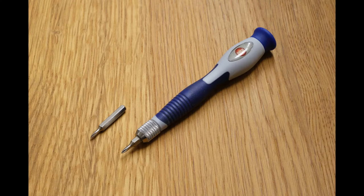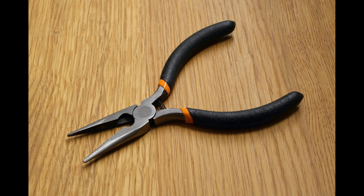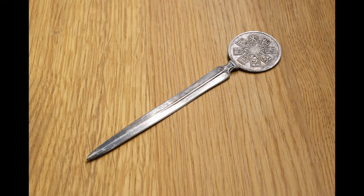So what we need are a few tools. First of all we need a screwdriver — a Phillips PH00 works really well. Then we need some tweezers; I use two here, one with a slightly wider tip and one with a pointed tip. Some small nose pliers are useful for disconnecting two of the connectors inside, and we need a soldering iron for disconnecting one cover inside the camera. Then we need to clean the sensor, and for that I used compressed air, acetone, and cleaning wipes. And of course we need a tool to remove the top of the sensor — that was very much improvised. I ended up using a letter opener, but you can use anything that works. If you find something that works well, do let me know. So let's get started.